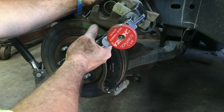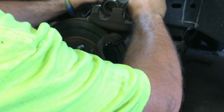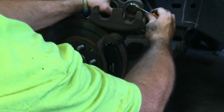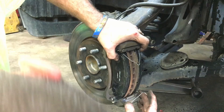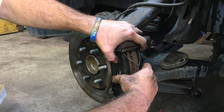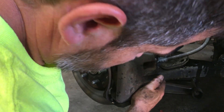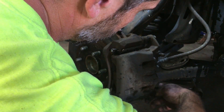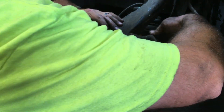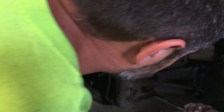Do one at a time — that one's all the way back. Release the air out of here. These little clips go in these little holes, just like that. You got your caliper pushed back — she sits up on there like that. Then you put your bolts back in there. It's just a matter of tightening up your bolts, pumping your brakes, making sure all the cylinders are back out, checking your fluid. You can stick a fork in this one — just tighten these bolts up.